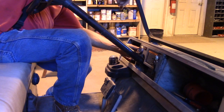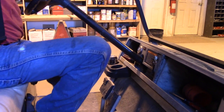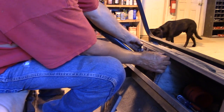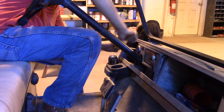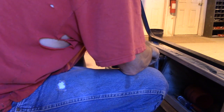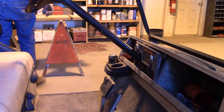If you just want to hook up a radio and have it hooked to the battery, you don't have to do this step. I'm exploring the possibility of hooking up the headlights so they only work with the key on. This should pull out — and there we go. I think all I have to do rather than disconnect the wire going to the battery for the headlights is clip it and hook it right to one of these two wires on the key switch, which will make things easier. Let me get my test light.